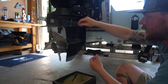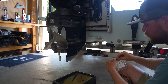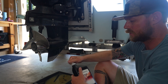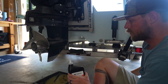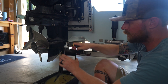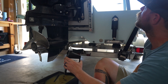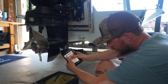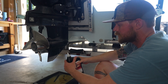I like to leave them up here on the cap plate so they're easy to get to when I start putting the new oil in. There are two methods to put new lower unit oil into your lower unit. The first one is you can take your gear lube bottle, take a pair of side cutters and cut the top at a bit of an angle, then basically stick it in the hole and squeeze. This to me is the messier of the two ways to do it.